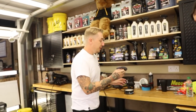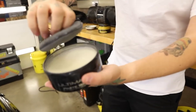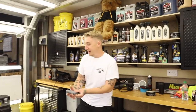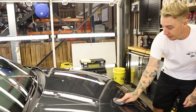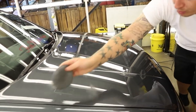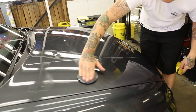Right, okay. Yeah. As we've been doing each time, we want to prime the pad. So this is how much wax you need. On the wax, half a turn. That's enough now to do the whole front end. So to make life easy for you, I'm gonna draw three stripes like that. And what we're gonna do is just one pass over it like that. And you should barely see it.